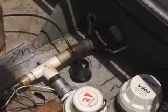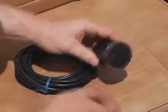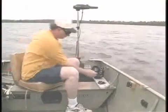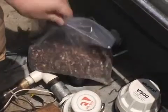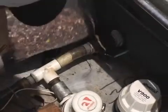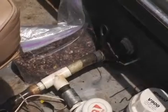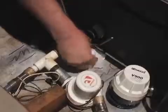To do this, fill the rear area of your boat with an inch of water before you permanently epoxy the transducer into position. Remove the protective film from the transducer face. Go for a boat ride and use a small bag of sand or gravel to hold the transducer firmly to the hull and keep it under the thin layer of water you have in your boat. Once you get your boat on plane, see if your bottom readings are not lost. If they are, try a different position until you find an area where your sonar sees bottom at all speeds. Once you have found the best location, you can go home and drain your boat.